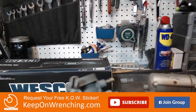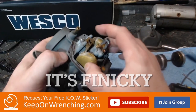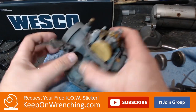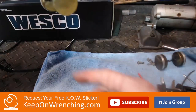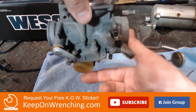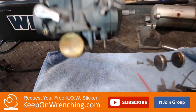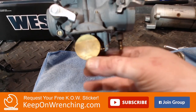That's the method — you might have to do it 15 or 20 different times, but it can be done. Get it right to 26 on this one, because this thing is going to hang like this. Gas is going to push and close that valve at that perfect moment. That's really what's going on: it hangs like this, gas comes into the bottom of the bowl, and shuts that valve off. Be specific on that.